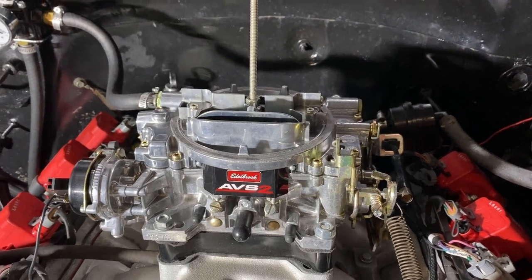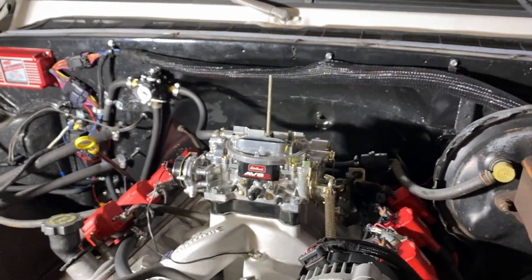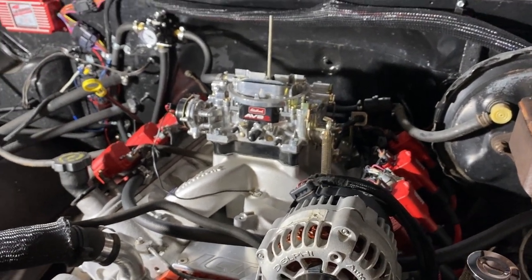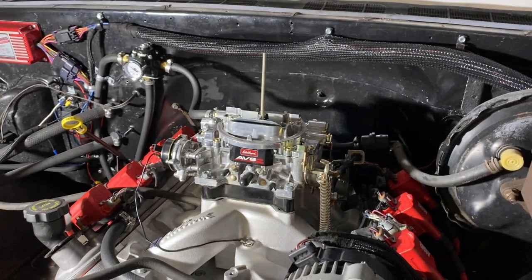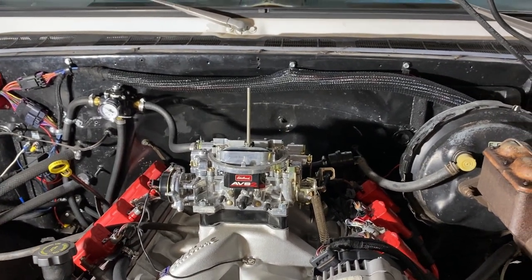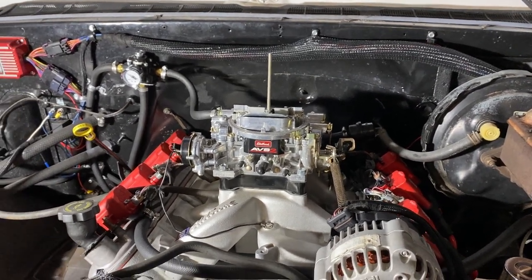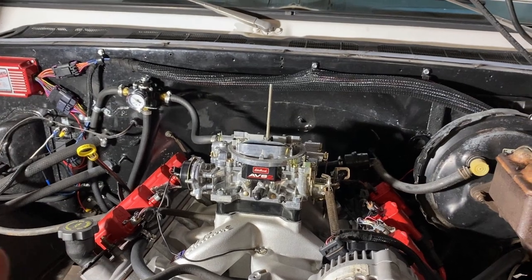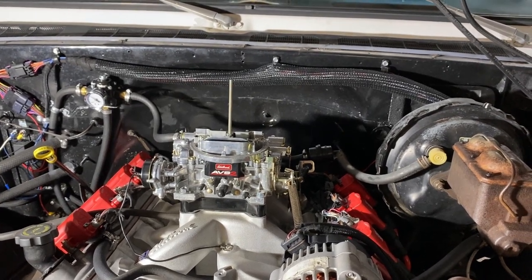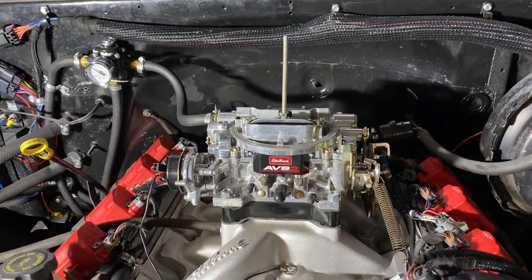This is an 800 CFM. I went out, took it for a ride, stepped on it, and watched my air fuel ratio gauge. I was running into an issue — at a low RPM when I would put it to the floor, it would go lean and it would sputter, pop, bog down lean. And when I would go from about quarter throttle to half throttle to pass somebody, it would get really lean and you'd hear like a sputter or this chop. So knowing that it was lean, I went and got an Edelbrock calibration kit.